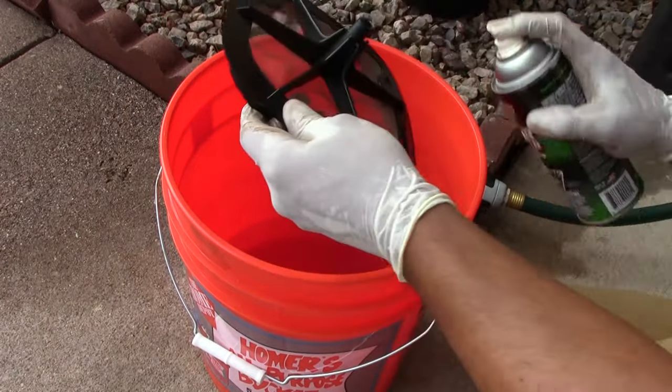Now we can put the filter back into the bike. We got it lined up — it has an up arrow on it, so it's kind of dummy-proof. That side's in, and then this side's in. I'm going to feel in the back to make sure that it's seated all the way around the air filter — it should be seated up against the air boot. And just put the air box cover right back on. And there we go, all done.